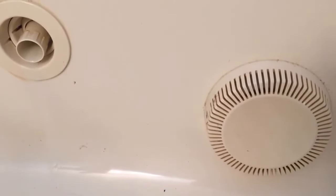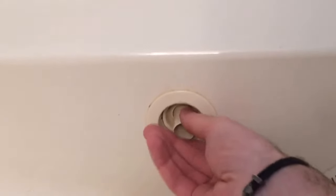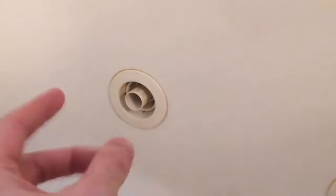If that's not the problem, I would recommend looking at the jets yourself. I didn't realize this, but the jets in my tub actually turn left and right and they close and open — I had no idea. In fact, since I've lived here for a couple of years, I always thought one just didn't work and all the other ones were working, but it was closed. I finally figured out it was just left to open, right to close after all that time. So if you hear it humming but you're not getting anything coming out, maybe they're closed. I actually didn't realize mine were working — I had used a scum buster tool, like a rotating brush, and I guess it had closed them all. I only had one working and I thought I had a clog somewhere, but that's all there really is to it.